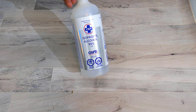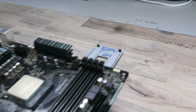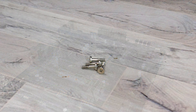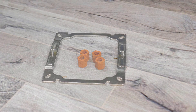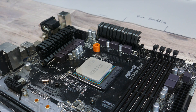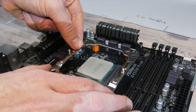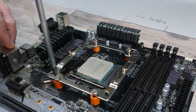You should also have some isopropyl alcohol and something to wipe with. To install onto an AM4 or AM5 motherboard, you will need the backplate that came with your motherboard. With the CPU installed, place the backplate flat on the mat, then align the mounting holes on the motherboard to the standoffs on the backplate. Find the AMD mounting screws, plastic spacers, and mounting plate. Place the spacers over the standoffs, align the holes on the mounting plate to the spacers, then place the mounting screws through and fasten them to the backplate.